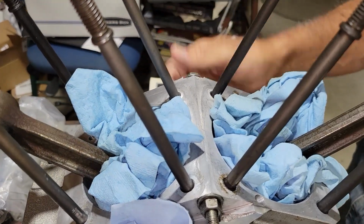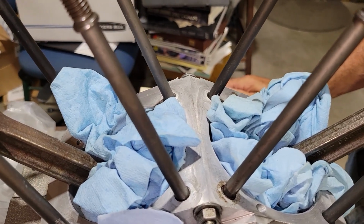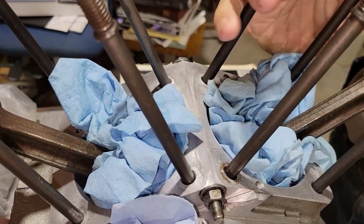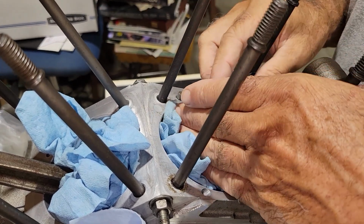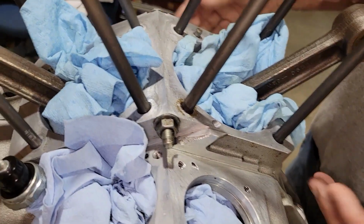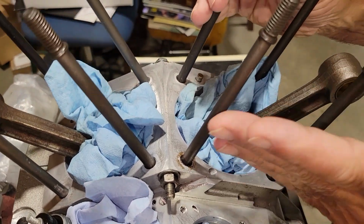Or replace the studs, if we even remembered that this is an early motor or not, because some bikes you can't tell what it is, since they have it all customized. But you take it apart, and if they're upside down, you turn them over. That's just a common practice. But most shops may or may not even know that service bulletin ever came out. Like this 97 service manual I have, it tells that the other way is the best way, and you don't have to worry about height.